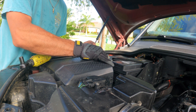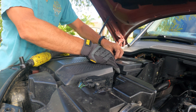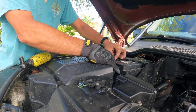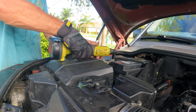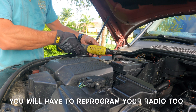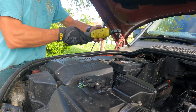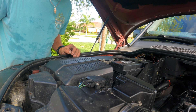Let's go ahead and try it on — see if you can hear the click. There we go. Now just tighten up the battery pole again. I use a wrench here, but do it by hand instead because you can better feel it. There we go. The computer is now reset and you should be ready to go out and try it out.